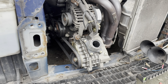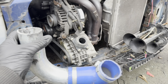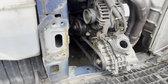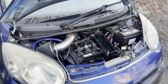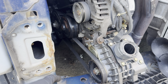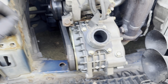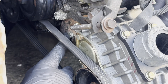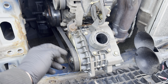I was expecting it to join from the bottom and blow out from the top but it actually sucks from there, and that is where I've got to look out for where all this pipe would fix. I think that goes something like that but for me that's a job for another day because it's freezing and I've had enough. As if by magic it is now another day and it is still freezing. Since last touching it a couple of days ago I've been thinking about how this supercharger's actually mounted. I'm not massively happy about the belt angle and I'm definitely not happy about it being mounted just on one end. Really it wants a bracket making from there up to somewhere else somehow.